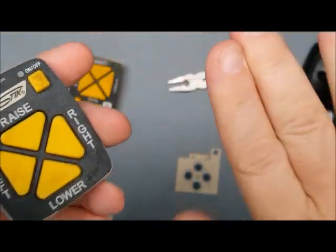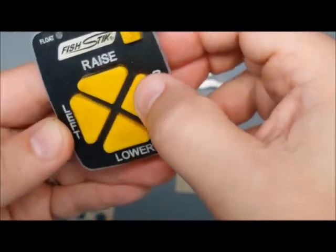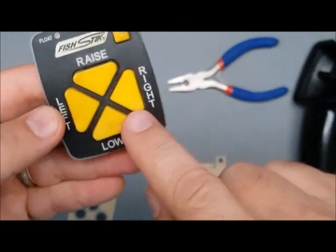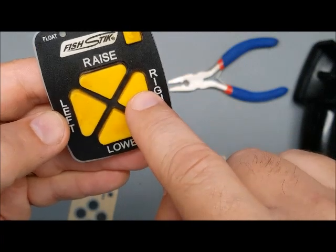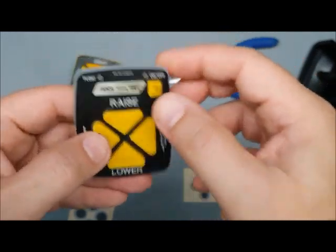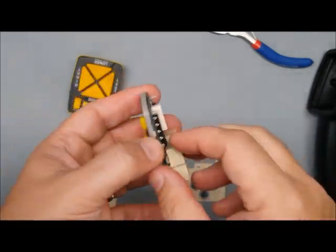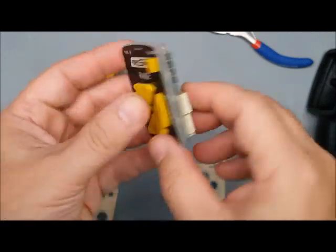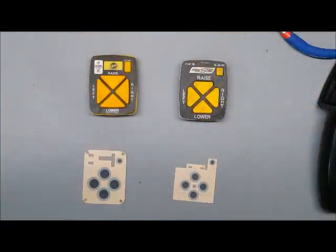It's a nice feature — the membrane keypad acts as its own button. Even if a button sticks down and doesn't pop back up, it still works because the button doesn't have enough strength on its own to hold down the membrane. So even when it's stuck down or the rubber is ripped, it's still working. Once it's all back together, hook it up to 12 volts — you should be able to turn it on and off, push the buttons, and hear the relays click to confirm it works before putting it back in the truck. That's it, thanks for watching.